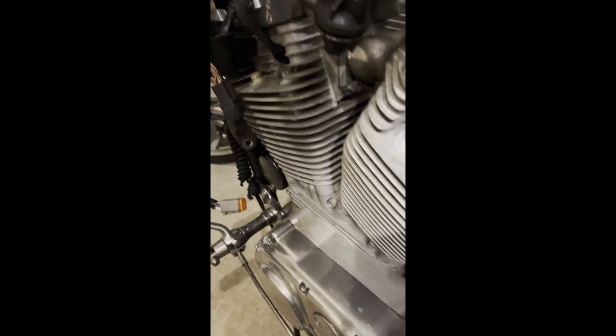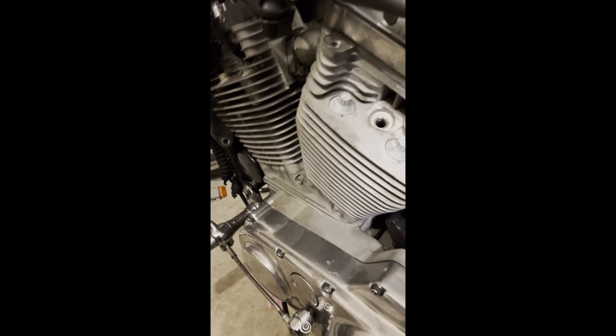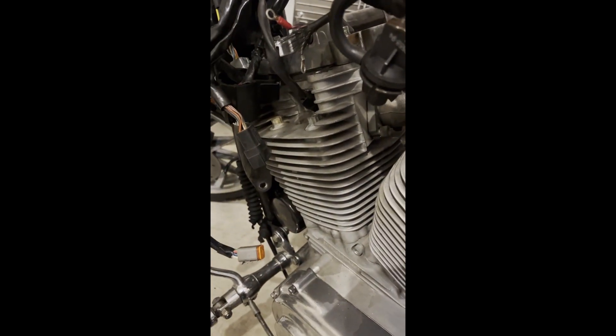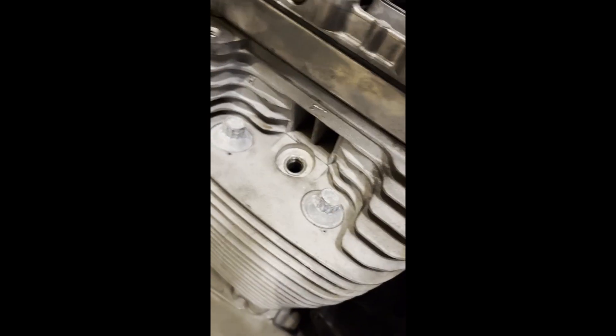I jacked it up and back down. I have the front piston at top dead center. The way I did that was I grabbed a pen to measure the cylinders through the spark plug holes. I got a little piece of paper — a Sweet and Low packet — and just set it on the spark plug hole. Then I rotated the rear wheel in high gear to make it easier, with the plugs out so there's no compression. Rotating the wheel will blow away the piece of paper, then stick the pen in and keep going. Once the pen stops moving up, you're at top dead center. If you keep going it'll go down. This piston should follow the other, so if you stick the pen in here and it fills pretty high, the back cylinder will be almost there but not quite.